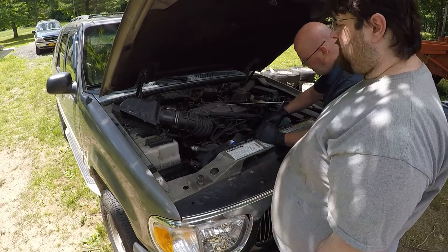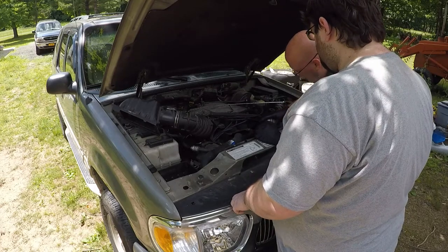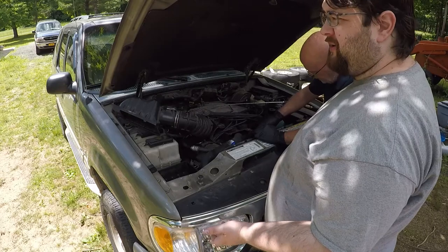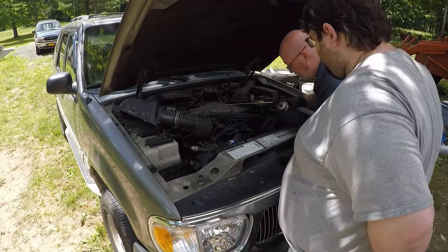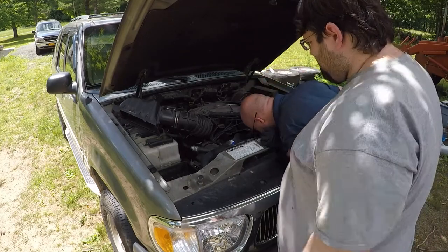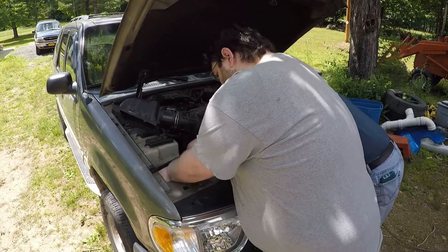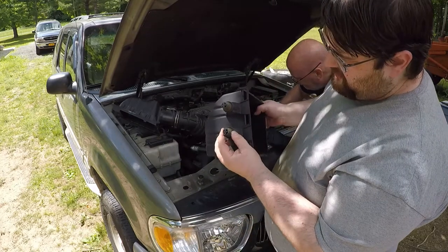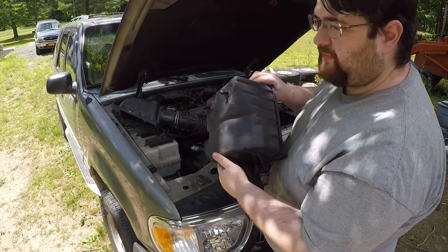You can do that. You should do that. Or you could just manhandle it out like a real professional. And then you will break the tabs off the bottom of the airbox, and the airbox won't stay when you put it back. No one needs it to stay. Why is this? You think this is some sort of actual educational channel? But seriously, yeah, spray it. Otherwise they will rip and tear, and unfortunately this isn't a Doom game.